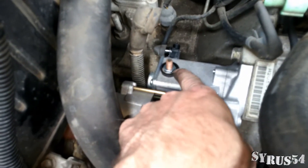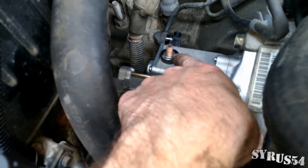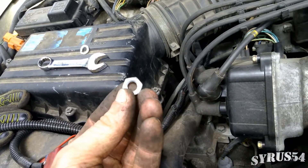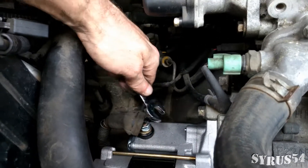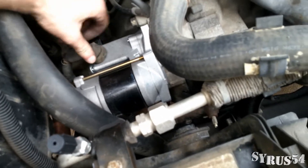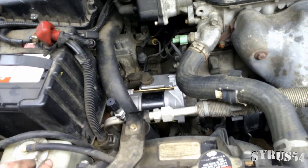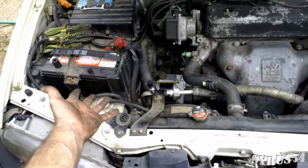The only thing about these little studs right here — you can see that orange color — that means it's brass. The only thing about brass is that it is soft. It absolutely hates it when you tighten it down. So when you go to put this on there, do not over-tighten it. If you over-tighten this, all that work that you just did putting in a brand new starter was all for naught, because your starter's going to be garbage if you can't tighten on this battery post. Your average starter today comes with a lifetime warranty — they'll even send out a tow truck if your vehicle breaks down. So why would they use such an inferior part? Anyway, now it's installed.